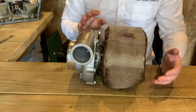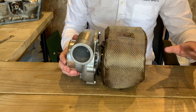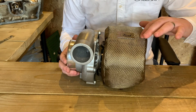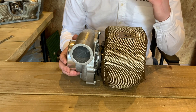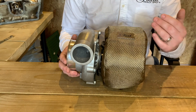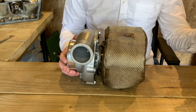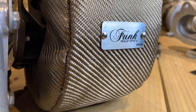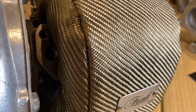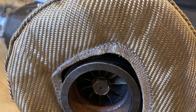Once you're happy with the overall fitment, you're ready to go and start the engine. What you'll notice over the first one or two heat cycles is you may see a slight bit of white smoke coming off the turbo blanket — this is very normal. This is just while the internal structure starts to form to the shape of the turbo; it's nothing to worry about and it should disappear after a couple of hard heat cycles. Now you can see some close-up images of the turbo blanket fitted to the turbo, and then we're going to move on to the internally gated system.